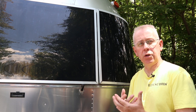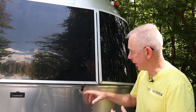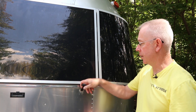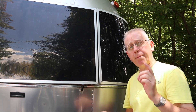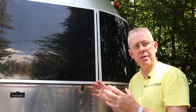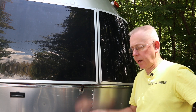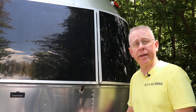If there's a good thing about filiform corrosion, it is that it is purely cosmetic — it doesn't actually affect the structure of the aluminum. That's another myth people believe. It's not like rust. It also doesn't propagate forever; research shows the filaments go anywhere from one to ten millimeters. You can see 15 years of corrosion at an area — it peaked, happened, and stopped. It won't spread farther, won't damage the material, and isn't going to spread forever.